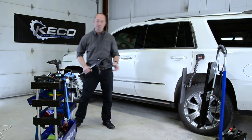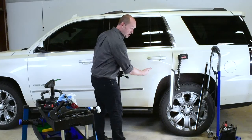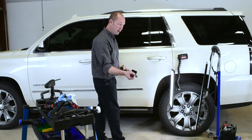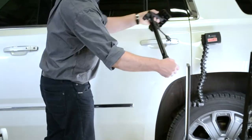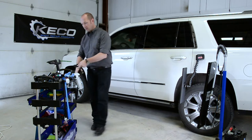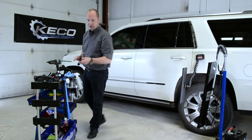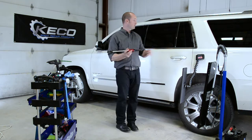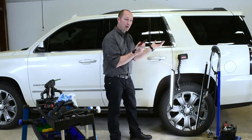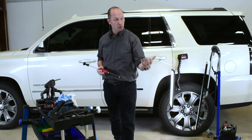A little bit smaller, the single-action lifter is our K-bar. When you're out of reach with one of the two feet on the beam, you can use the K-bar, put the foot anywhere you like, and lift the dent. The next tool to lift dents is the slide hammer. Near edges and rails, if you can't place the feet on one of the lifters, use a slide hammer to pull your tabs.